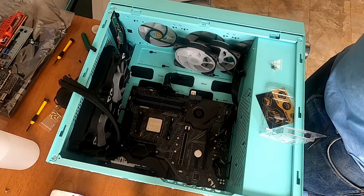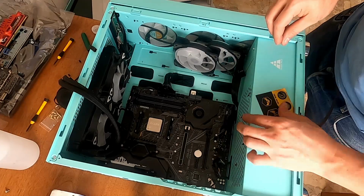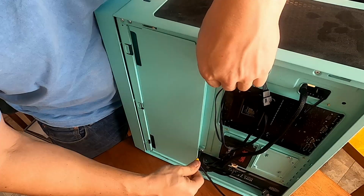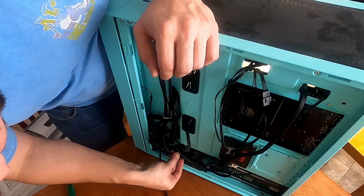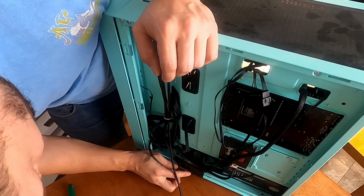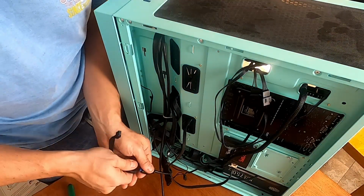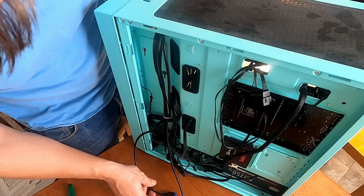What do I think about this? I think the old motherboard did not have USB 3.0. So I'm pretty sure I did an adapter, which I can get rid of on this computer. So let me check that. So this is USB right from the USB port. This is other USB right from the USB port. And this is the last USB. There it is. That's my converter. So this is USB 3.0. There, see? USB 3 to USB 2 adapter. Don't need that. These two are still USB 2.0. But now we get USB 3.0 on the front.